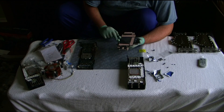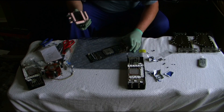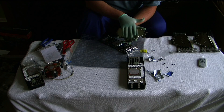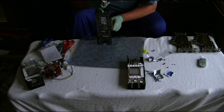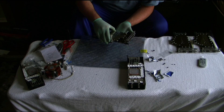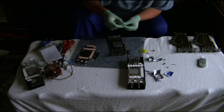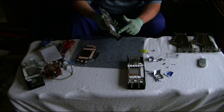All you've got to do now is put thermal paste on here. You can do either one first. Make sure that on most graphics cards the holes for the water cooling are opposite to when you're putting it in the motherboard. So you grab it like this and just put it at the top. There are ten screws — ten little screws that you've got to screw in at the bottom.